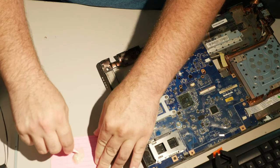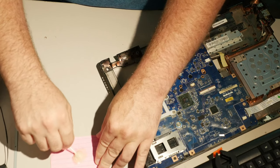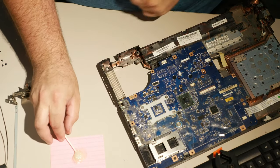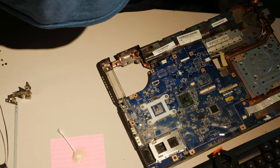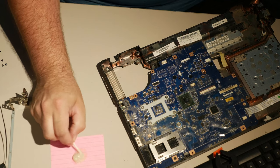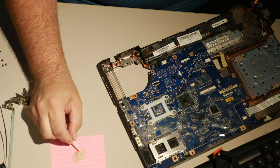Exposure to epoxy fumes causes you to become more sensitive to epoxy fumes. So, little safety tip, if you can have a fan running somewhere. In fact, let me do that. If you can have a fan somewhere to help ventilate the epoxy fumes so that you don't get nauseous and puke, because I got very sick off of these one day when I was not ventilating properly.